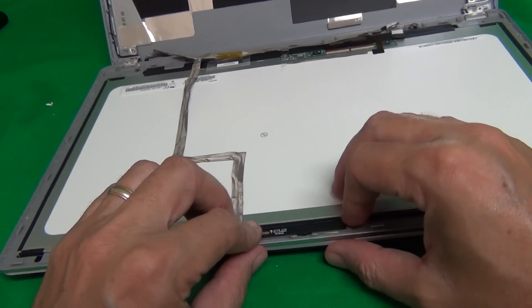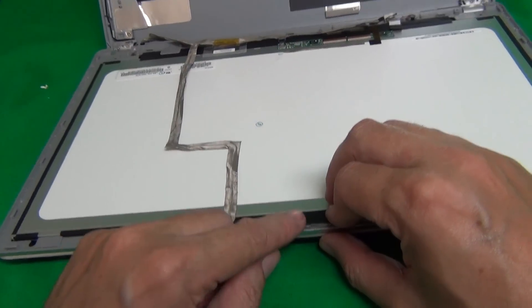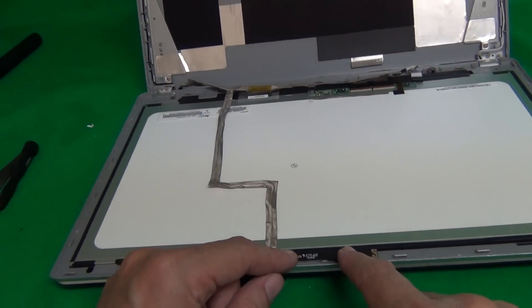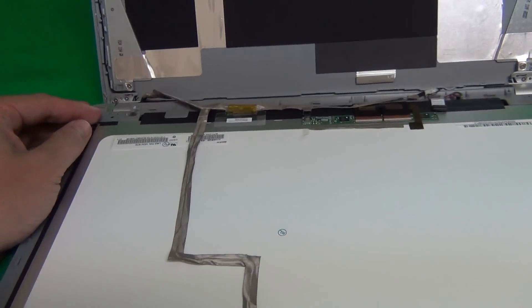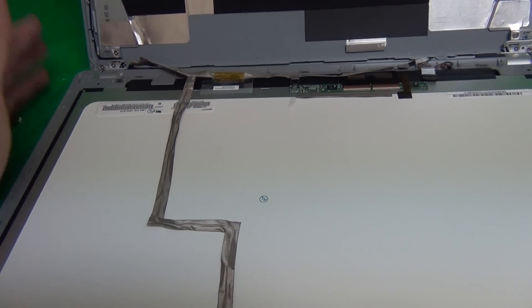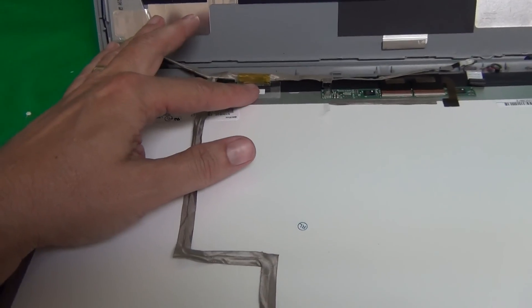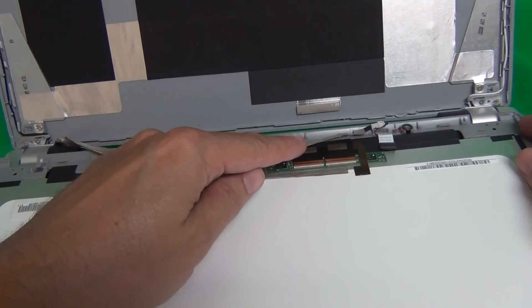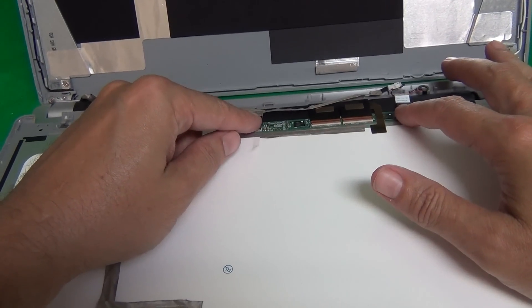Keep going in this manner. When you pry open on the top, all the way on the top, there's a stubborn corner that we still haven't gotten. When you pry on the top, we have to do the same thing on the bottom. There's a seam on the bottom of the laptop. Stand the laptop on its side and pry open the bottom until it starts to give.